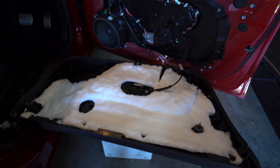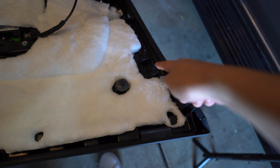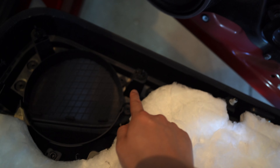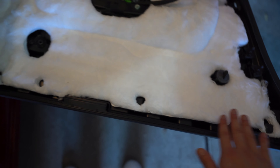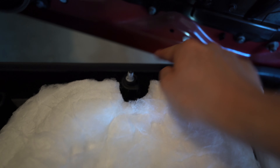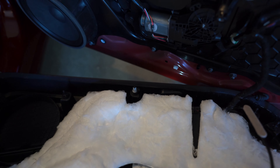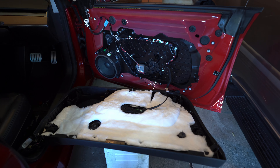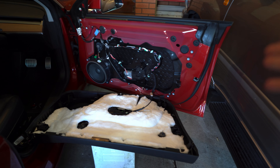So I've just popped off this panel. You'll see there is a lot of foam padding in there, and the clips are essentially around the edges. There's actually no clips on the top edge where the window is, so it might be easier to start pulling from there and work your way around. It looks like one of the plastic clips came off — the white part should stay inside the frame; it's the female side to the male side of this clip. As long as it's not broken, it should be fine. This is what the inside of the door panel looks like. There was a bit of a rattle, so I'll take a look around inside and see what I can find. This is basically how you remove your door panel on your Model 3.